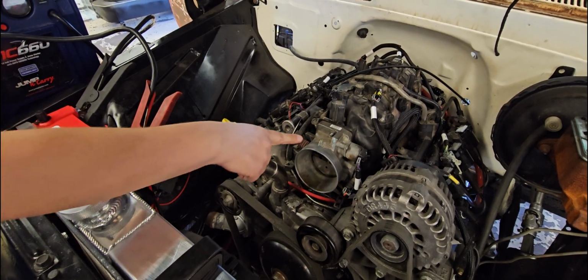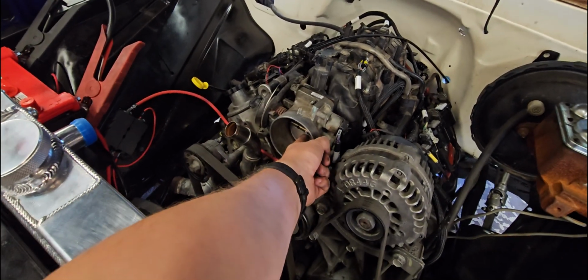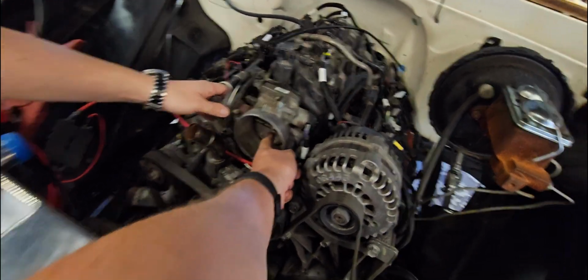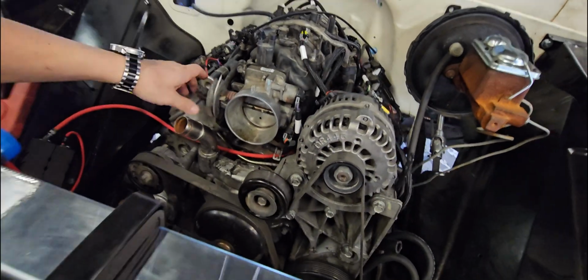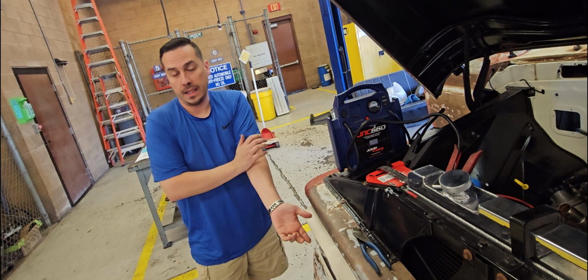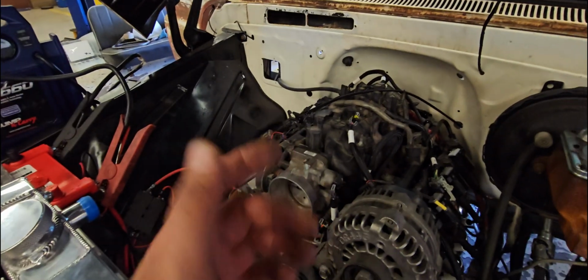I mean, you're essentially blocking off the idle air control valve. Well, and the hole in this. Right, but this is completely closed. Yeah, there's still a hole in here though. But if the idle air control valve is at 90%, which is what it's reading, that's a lot of air. All right, it's Torx bits, so I'll go get some Torx bits.